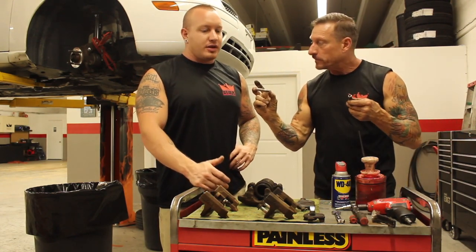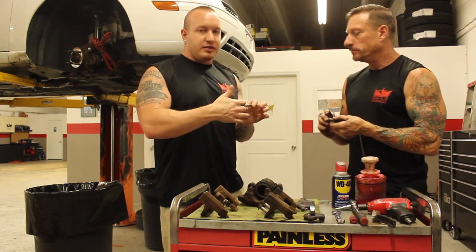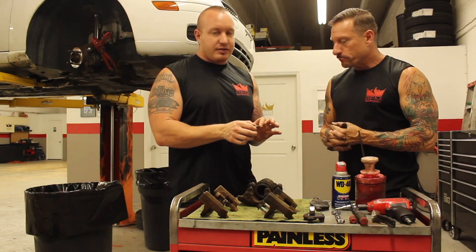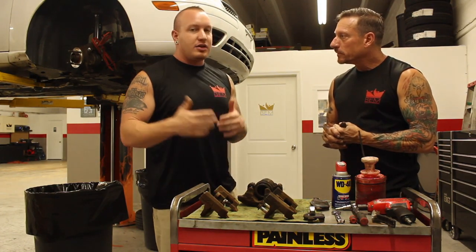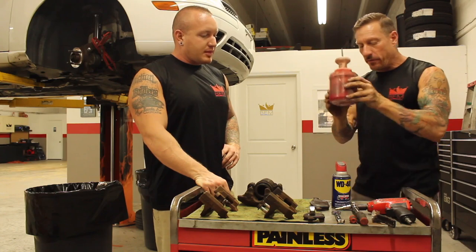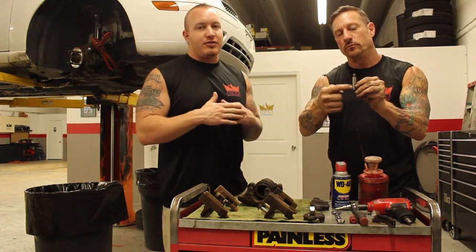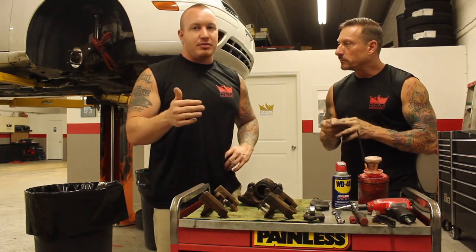Any sort of rust, corrosion, or contamination in any moving part of the brake system — in this case the slide pins — is a problem. The caliper actually just sits on here. This is more of like a stud, essentially, that the caliper sits on and slides back and forth as your brake pads wear down, as you step on that brake pedal, as you apply the brake and let off. Your caliper does slide on that. So you don't want anything on there that's going to cause binding friction. That could lead to calipers hanging up, wearing down the pads too fast, or even causing a lockout. So synthetic wheel bearing grease will be used on the coating of the slide pins — any surface areas where friction or movement is occurring — just a very thin amount, not caking the stuff on there, just enough to keep it from being metal-to-metal contact.